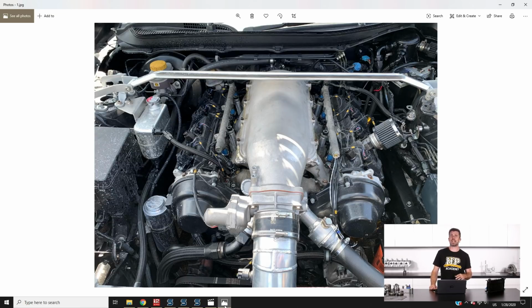I'm struggling to actually remember the exact details on that. I think that was actually just down more to the grease that we're running, not being able to handle the temperatures we see in an endurance race. Anyway, we thought that the obvious upgrade, considering we were aiming to make more power over time with the car, was to jump up to Driveshaft Shop's 1,000 horsepower axles. So we placed an order for those. They are made to order, so it took a while to get them in.